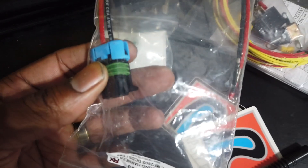I know what you're thinking — if I'm just going to use the factory harness, why do I still need a relay? Well, a bigger pump takes more amperage and voltage. Your factory fuel pump is on a 15 amp fuse under the hood, and you're just going to blow that. You could put a bigger fuse in there, but then you risk setting your car on fire because it's too much amperage going to your fuse box for what's supposed to be a 15 amp circuit.